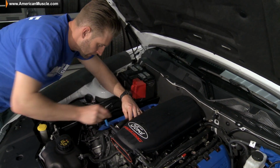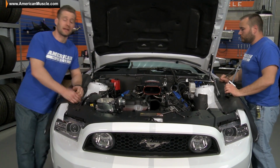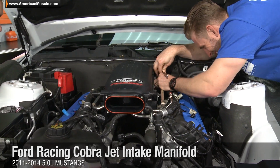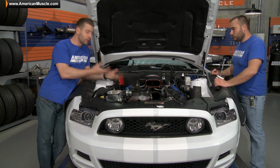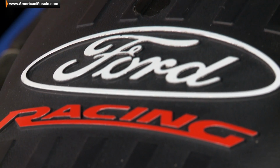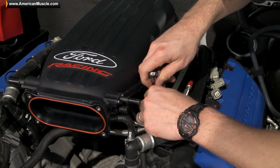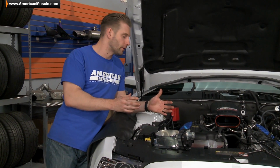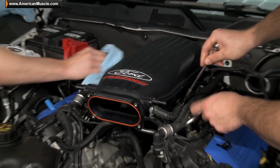All right, guys, some of you may have recognized this bad boy. That's right, I'm going with the Cobra Jet intake manifold. A lot of you guys have been asking to see it on our YouTube page, and I've been dying to do it. So here it is, man. We're gonna throw this thing on my 14, see how it does. If you don't know about this, you can expect a lot of top-end gains without any of the torque loss you'd see with a Boss manifold. So it's kind of a rare thing right now. Not a whole lot of people are doing it for a couple of different reasons, but you can't deny the gains. So hopefully this thing delivers.